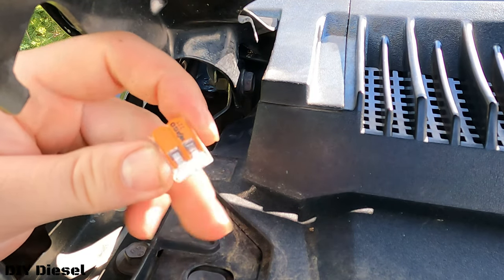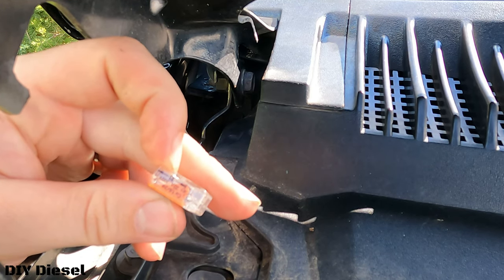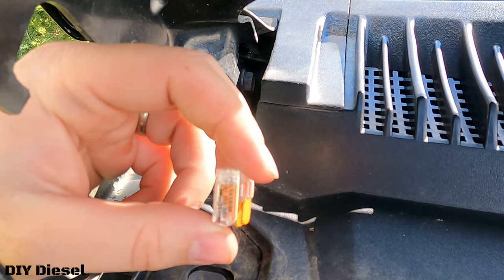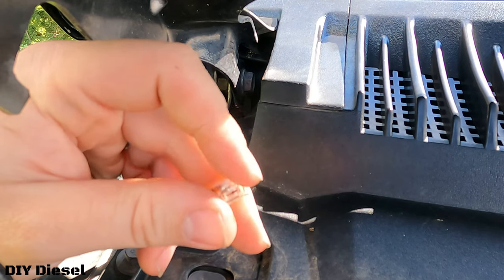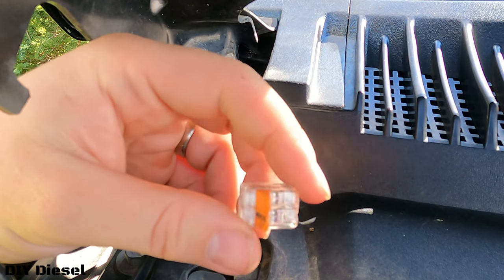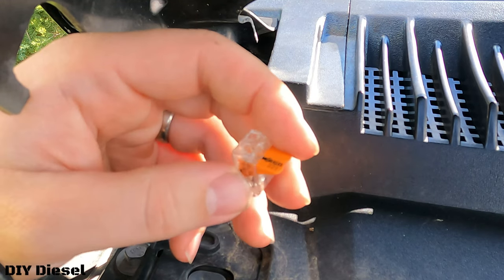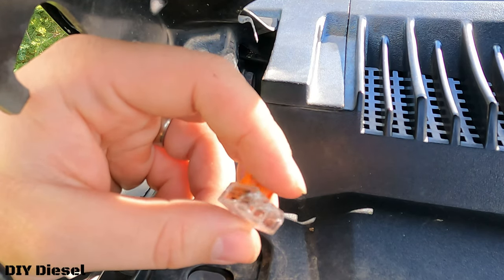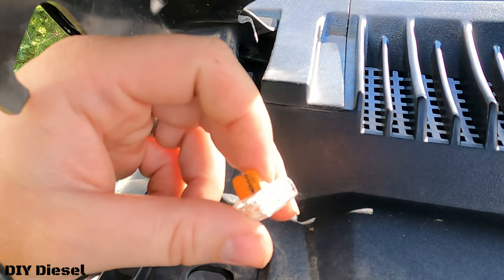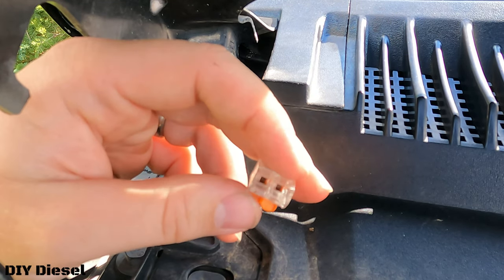I will be using Wagos. If you don't know what these are, they're the 221 series. They are 12 to 24 gauge, I believe. They are a clear body with a snap lever, and these things are absolutely awesome, you guys. This is what you should be using, 100%. I will leave a link below for these if I can find them somewhere other than Electrical Supply House. These are honestly the future of realistically replacing wire nuts as well as butt splices, everything.